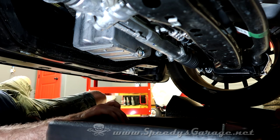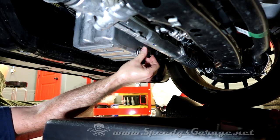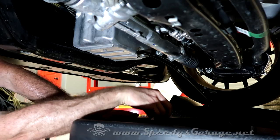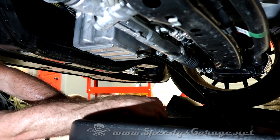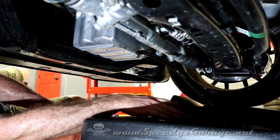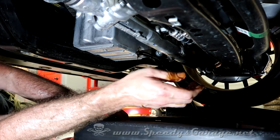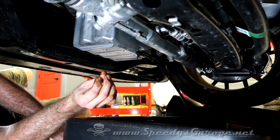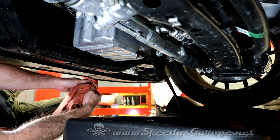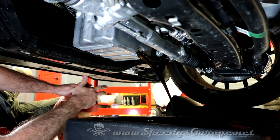You're going to do this with the car at operating temperature, so be aware that it could be a little warm. I don't see any glitter or metallic issues in the oil, so that's good. This is the break-in oil change — about a thousand miles on the oil. It's a little dirtier than I would have expected, so it's good that we're changing it.